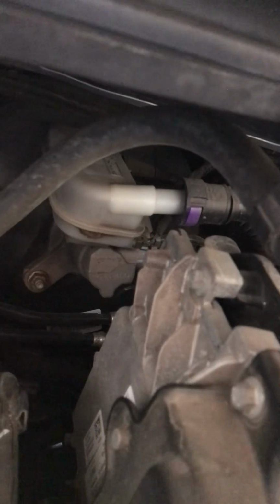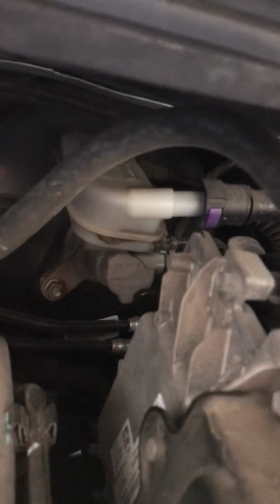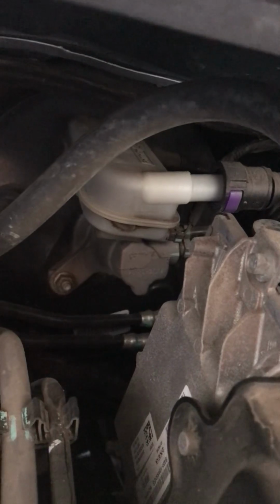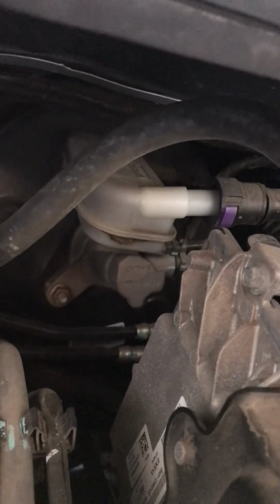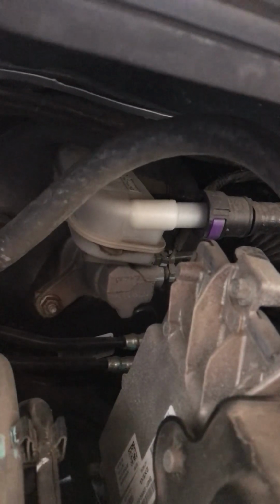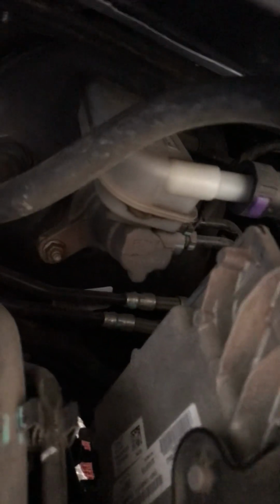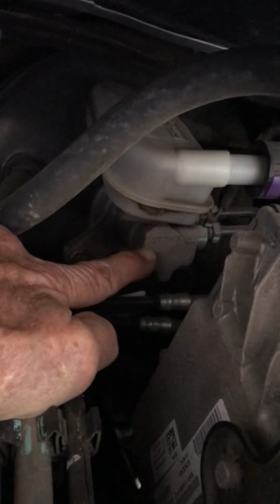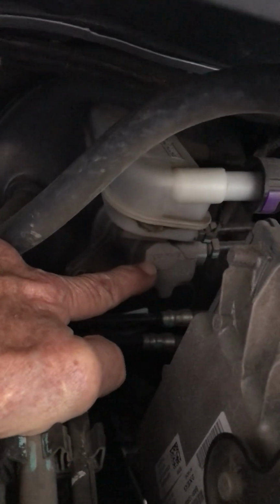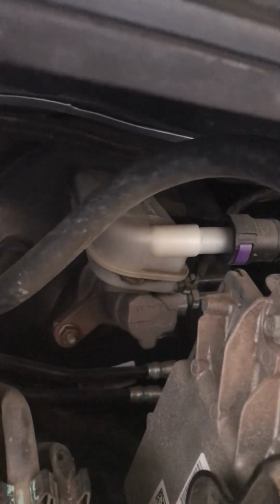And you don't ever want to have a leak in your brakes. You don't want to drive the car with a leak, because if that leak gets big enough, well, the brake light's going to come on, and then soon after that, the brakes will not work. They may be working fine when that light is on, but as soon as the fluid leaks out to where air can get into that cylinder below. This cylinder, this is the master cylinder. As soon as air gets inside of there, it cannot put enough pressure on the brakes anymore, because it's just compressing the air and it's not going to stop the car.